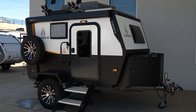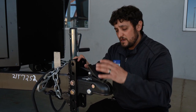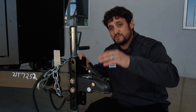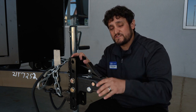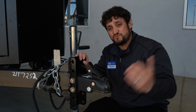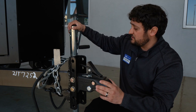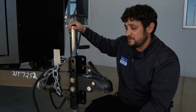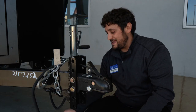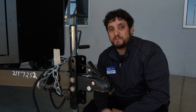Since we were talking about the structure of the Ember, I wanted to bring you to the front of it. We're sitting in front of the tongue here. This coupler is nice because it's adjustable. So if you have a lifted vehicle, you can adjust this so you can tow the camper level — you don't have to worry about tearing off stabilizer jacks or buying an expensive drop hitch. Just by loosening these two bolts, you can raise this up and down. Another nice feature is this tongue jack that you pull and it swings up, so it's parallel with the frame. You don't have to worry about anything hanging down when you're towing through dips and bending your tongue jack before you get to your camping destination.